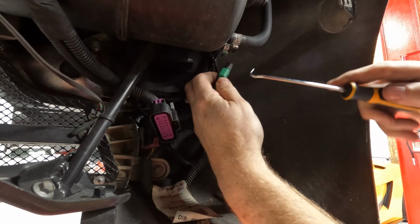All right, YouTube, got the car ignition on. Dongle is plugged into the OBD port and we choose work, writing, and DME, the my file. Okay, yes. Okay, master ECU, start of write. Yes, it's on a battery tender. Switch on the dashboard, check the connections, and press OK. This thing writes a lot faster than the other tool we used. Switch off the dashboard to continue. Okay. Switch on the dashboard. Give it a moment. Okay.